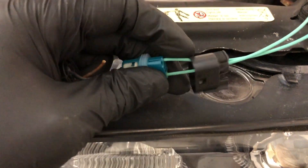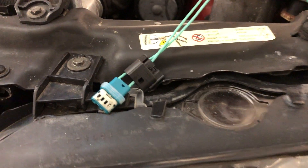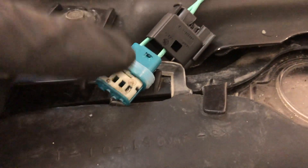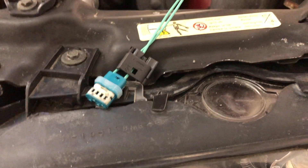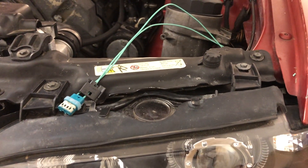So I bought this connector and a couple of these BMW wires that have the pins already in the end of them. This little white part here pops up, you slide the pins in, pop it back down, and this goes back on — and you can connect this into the new pre-facelift bulb holder and this will work.